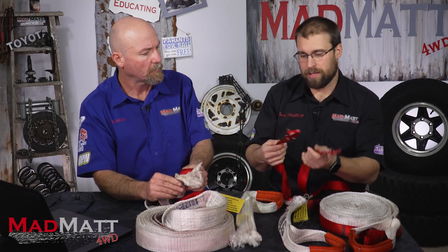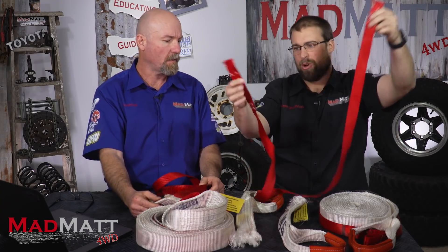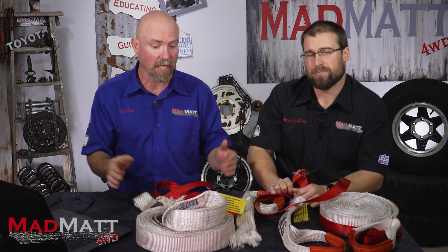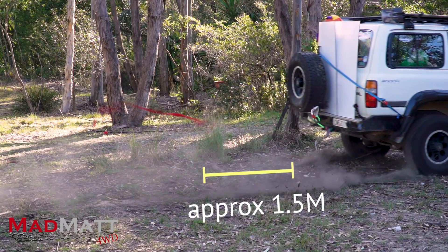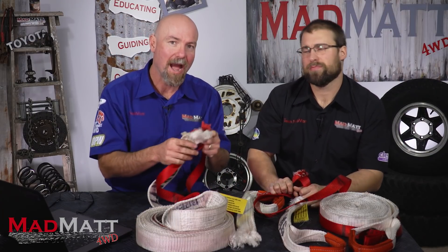After our initial discussion, we thought — well, it's not a particularly long tether, we're talking about under a metre. One of the things with a snatch strap is they're designed to stretch, roughly about 20%. This is a nine-metre strap, so we're looking for about a metre and a half of stretch before it's fully loaded and the fuse should fail. We looked at the footage and did some very rough calculations — it did go to about a metre and a half of stretch. You could see the snatch strap get to light tension, and when it failed, the vehicle had travelled about a metre and a half. This is what actually broke the tether — that metre and a half of recoil, the snatch strap trying to return to its zero position.